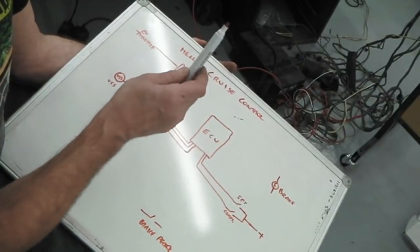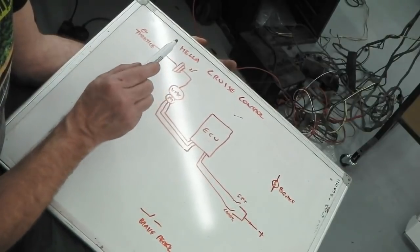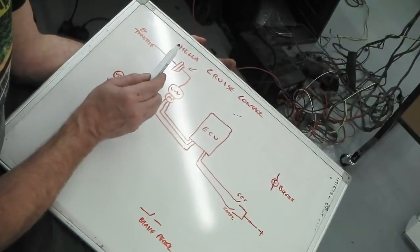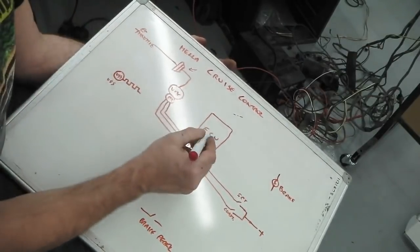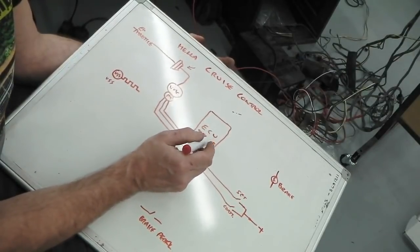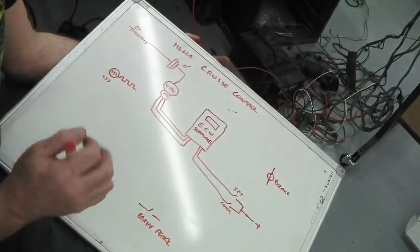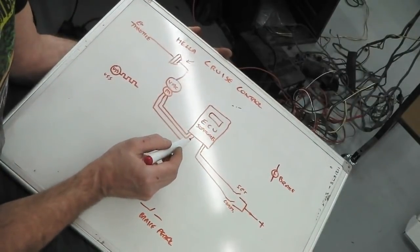That little dump valve only lets a little bit of air out. So little pulses on it, little click, click, clicks, makes the bellows sort of click, click, click out. Then a little pulse on the pump will bring them in. ECU does all that work. That's all built into the software of the chip. All hardwired, all hard encoded into the microchip there. We don't need to concern ourselves with that sort of self-contained unit with a multi-plug on the bottom.